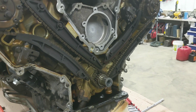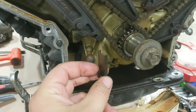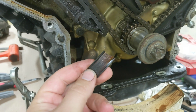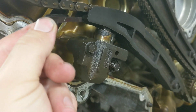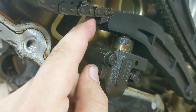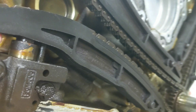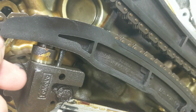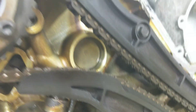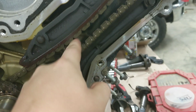After further inspection we found this little piece - it's part of the liner of one of the timing chains. It probably went right there because it fits in there too well. If I take that out, this one chain is much looser than this side.